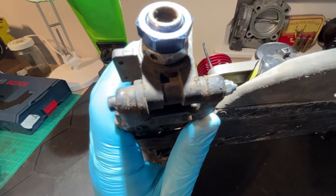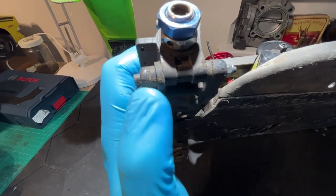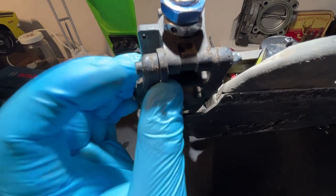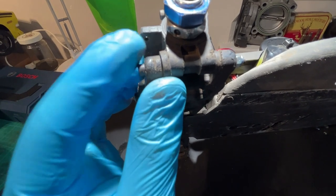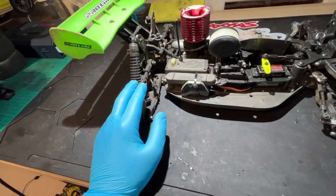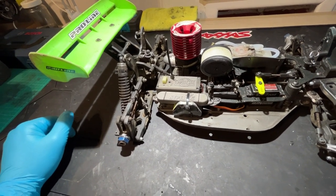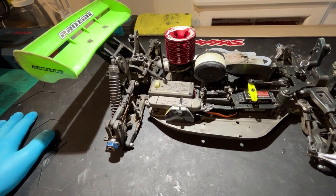One thing I've just noticed — I'm pretty surprised I didn't notice this before — but this is like a rubber bush. It should have a plastic piece here, so this needs to be changed out because that's going to be binding up the suspension quite a bit. Also this screw is bent because the knuckle can move around due to the rubber, so that's bent the screw. We'll get that screw replaced, get the new part in, and that will be sorted. You've already seen me take apart this rear end before, so go back to some of the previous episodes if you want to see how I tore this rear end down.